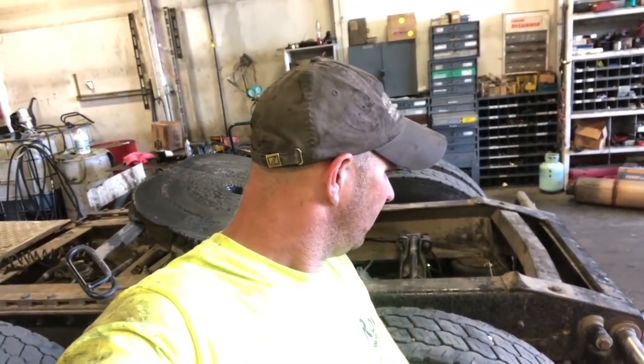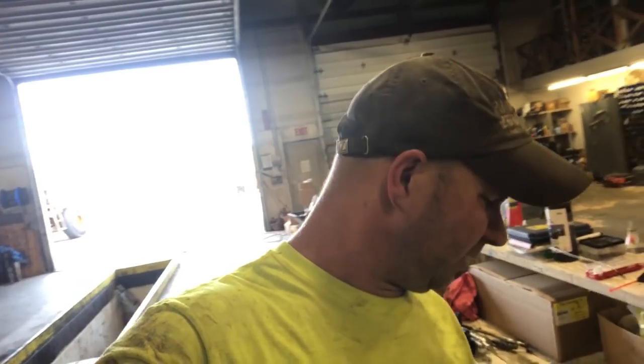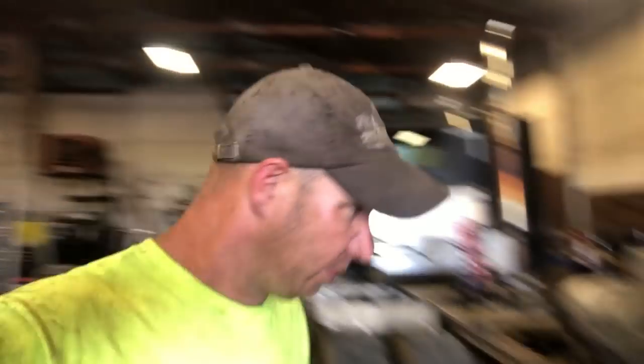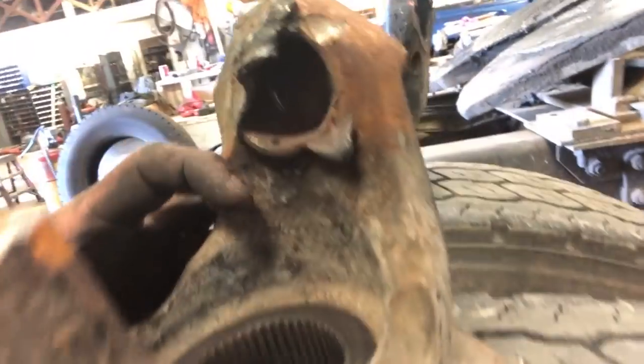Surely something was running in a bind and it cooked. Or did I grease it and somehow get spazzed out and forget to grease the back U-joints? It don't make sense. Something ain't adding up. Well, if I did, it was my stupid mistake. There you are, there's a dry cap. And there's his partner over here. See how dry he is?